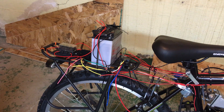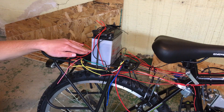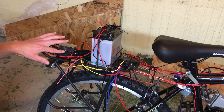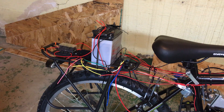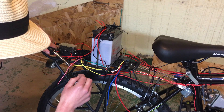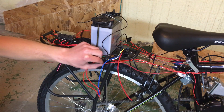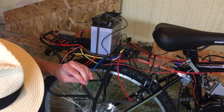You can find some diagrams from the links in the description for the different kinds of voltage regulators. Now that that's wired up, basically all we have left to do is run our jumper wire for these other two circuits, then solder all the connections, tape it up, and make it look nice. Now that we have most of our connections soldered and taped up, I'm going to go ahead and put on the lugs so we can connect the wires to the battery.